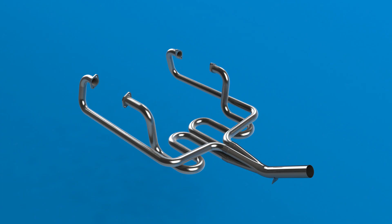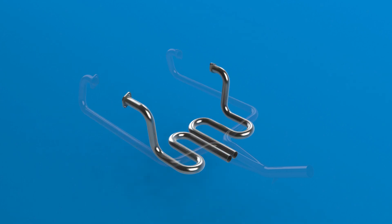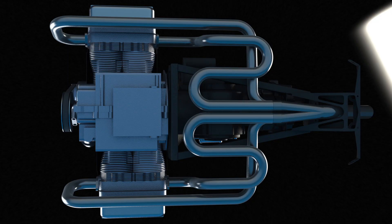All four runners need to be the same length in order to get the same effect on each cylinder. The front cylinders were quite simple to design the runners for — they had a simple direction reversal before coming together towards the centre to meet the collector. The rear cylinders were less simple. I had to run them straight down after the cylinder to miss the drive shafts, then direct them in an S-shape to get the required length. By slightly varying the left and right hand sides I was able to achieve the same length on all four runners despite varying cylinder positions.